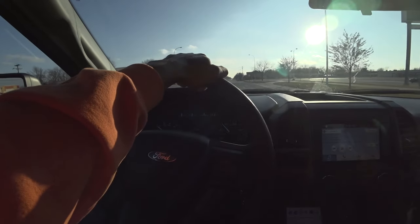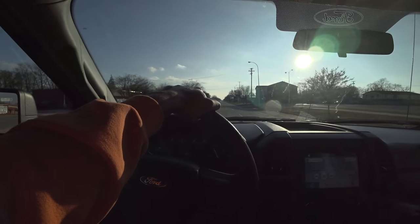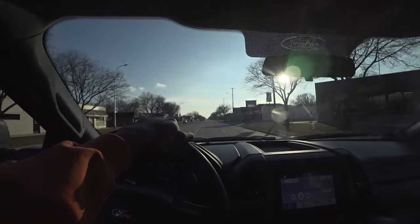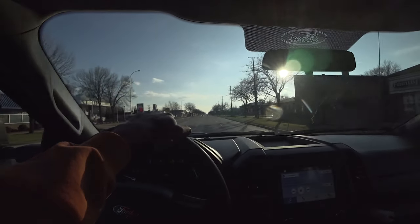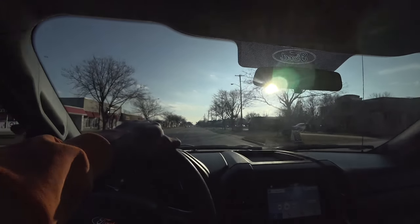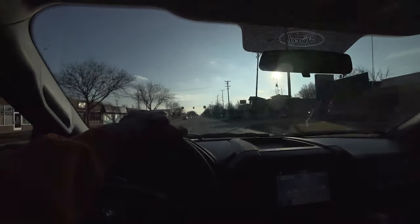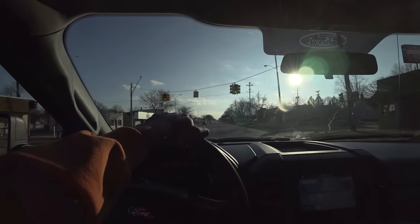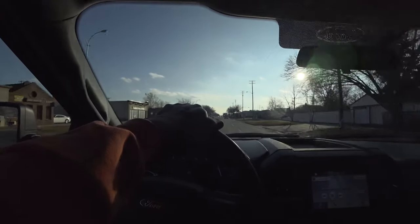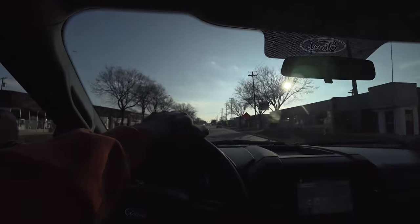With this much weight it almost feels non-existent — very peppy — whereas the other truck with the 3.73 gear set would have felt a little bit slower. But when you hit the brakes, you really feel them a lot more with the 4.30 gear set compared to the 3.73 gears, where you get a lot more engine braking. That truck had around 25,000 miles on it but the brakes were like brand new, and the tires were worn out. I think the brakes lasted so much longer because tow haul mode with the 3.73 gave so much more engine braking.